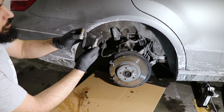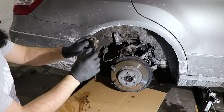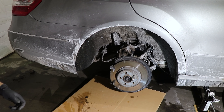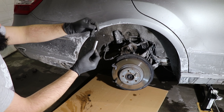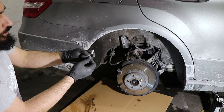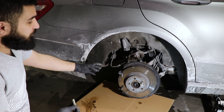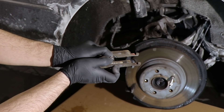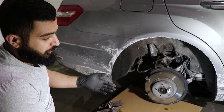I went ahead and cleaned the bolts over here. The only tool I used is a metal bristle brush — you can just brush the rust off and make it look brand new again. You're also going to need to clean these pins. They're kind of greased up with caked-up stuff on them. You don't want that to cause uneven brake wear. You need to lubricate them every time you replace the brakes. A buildup might squeeze one side of the caliper more than the other and cause uneven wear, just like I got over here. I'm going to make sure this is fully lubricated with silicone paste so it wears evenly.